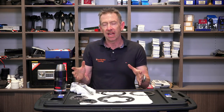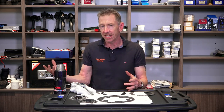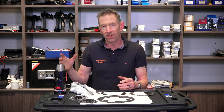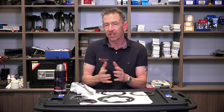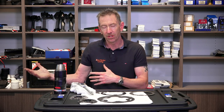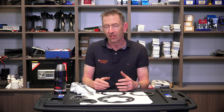The other problem is that sometimes people replace their chain rings and especially the cassette when they put a new chain on and they really didn't need to — that's a waste of money. If you've been running a high quality lubricant with good maintenance and haven't let your chain run too long, your cassette should easily take a second chain, sometimes even a third if it's a really good steel cassette. There's no golden rule that you must replace a cassette when you replace the chain, especially if it's a high-end cassette costing hundreds of dollars.